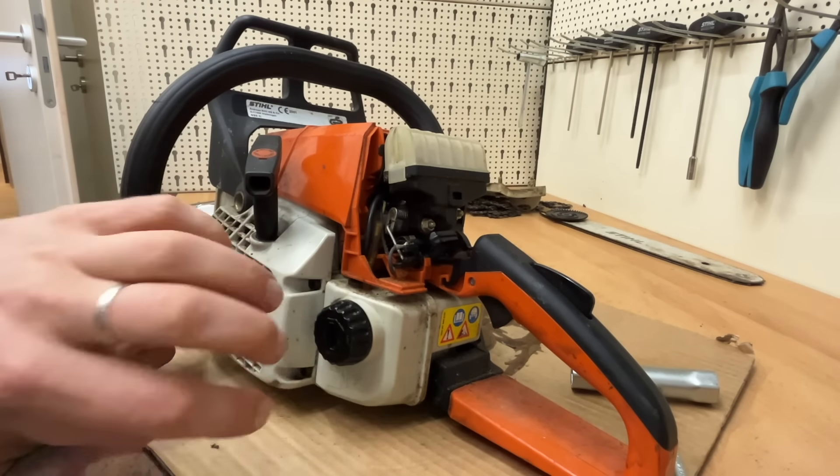Now we replace the sprocket and I'll show you what this sprocket looks like. First take a small screwdriver and release the C-clip. Clip to the side, cover plate off, and then the sprocket should pull off. As you can see, this sprocket has really strong wear marks. The teeth of the sprocket are massively worn down. When a sprocket shows this kind of wear pattern, you can confidently throw it in the bin.